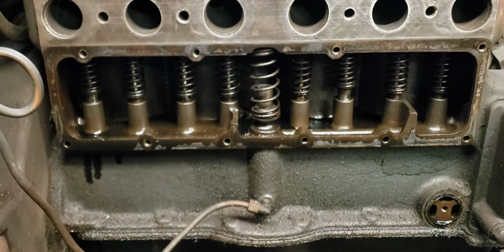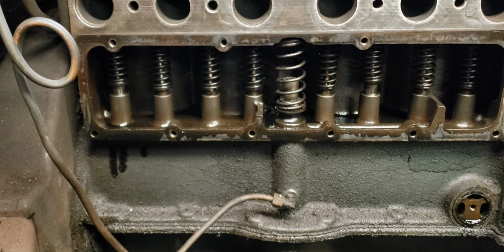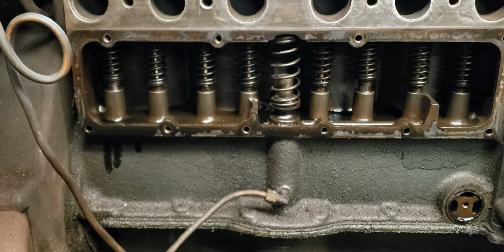Mine's a Model A engine, and cold, you'll get about, I don't know, 15, maybe 20. At idle, when you're revving down the road, you might get 25, 30, but once it gets warm, it's 0. Unless you're really screeching it down the road, and you might get 5, and people freak out. Well, that's kind of how these are. These are not pressure fed.